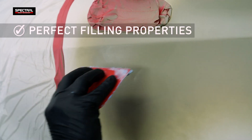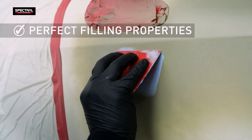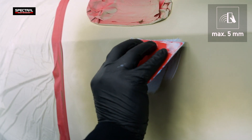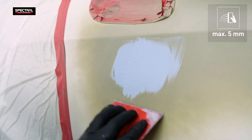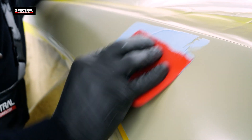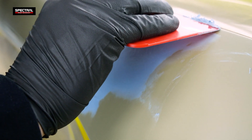FiberLite is created for extensive defects and irregularities, filling in the initial stages of surface shaping, like after body metal working. The glass fiber filler forms the internal structure, which ensures minimum volumetric shrink and high mechanical strength.